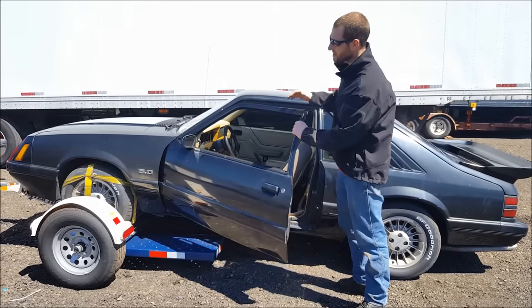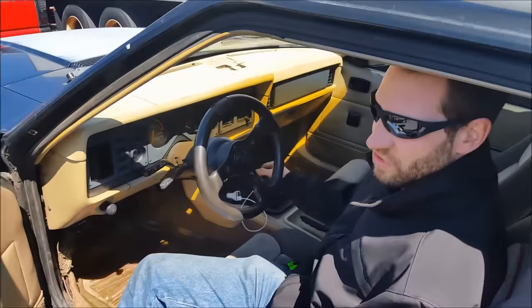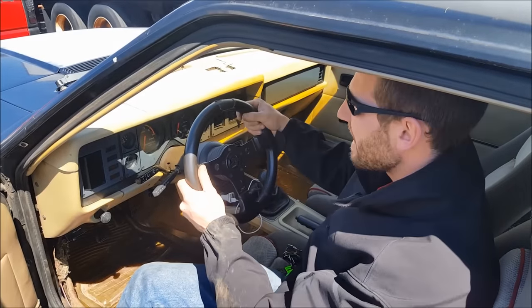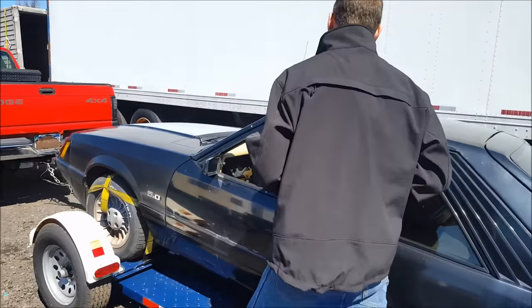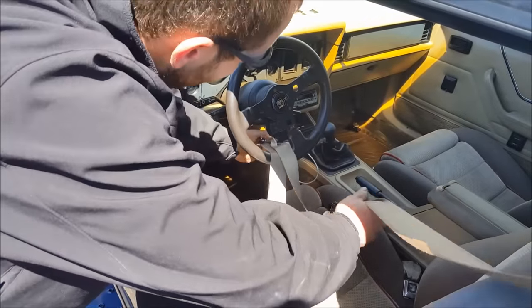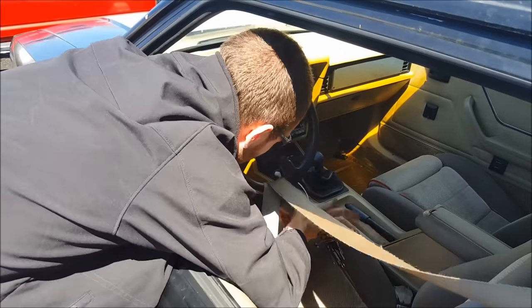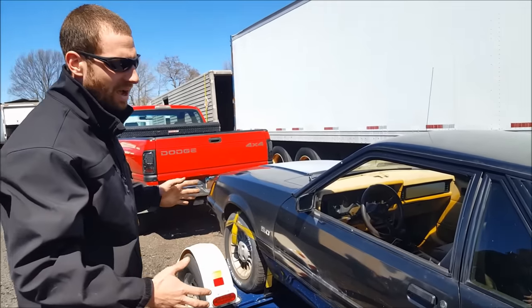Now that we've got both tires securely strapped down, you're going to go in here, release your parking brake, and since this is a manual transmission, make sure to put it in neutral. Then you're going to take your key out of here and if it's equipped with a steering lock, make sure the steering's locked. Now if you don't have a steering lock — and I recommend doing it even if you are using a steering lock — you're going to take your seatbelt, get plenty of slack in it, wrap this around once and twice, and buckle it in. The reason you're doing that is you don't want this steering box to turn.